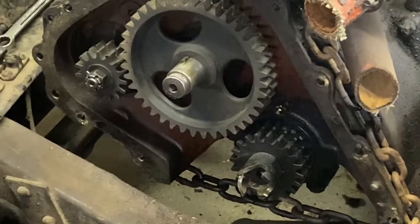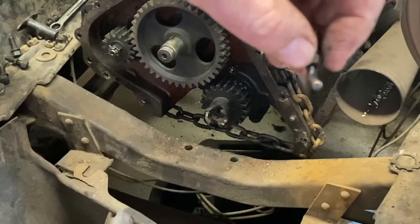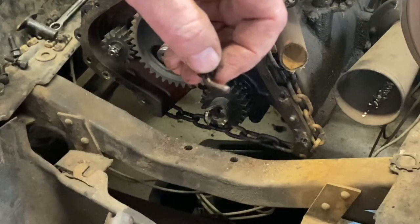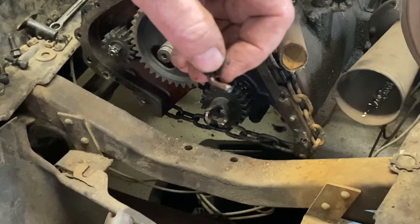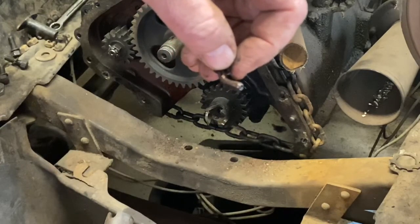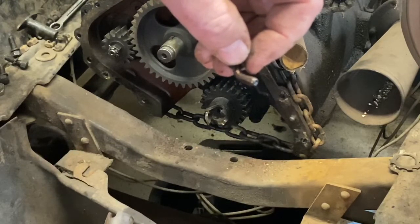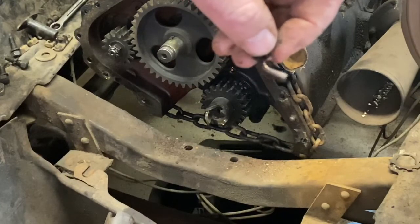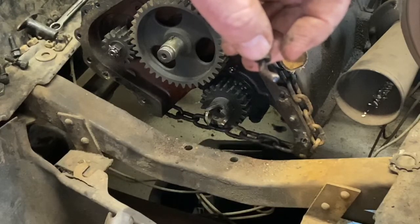Confident the oil galley is okay, but I'm concerned about the tip of the nozzle here. I'll show you what we got. Just a little nozzle thing that drips oil out. So I want to get my air gun and blow that out. Make sure that that little tip isn't plugged. The other thing that I didn't do last time was I meant to goo it, is that a word? Goo? Anyway, put some kind of lubricant all over that timing chain, like STP or something like that, so it's really sticky and keeps oil all over that chain assembly as this engine fires up for the first time.